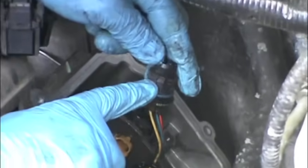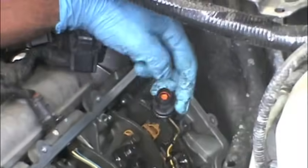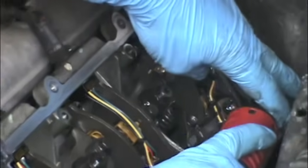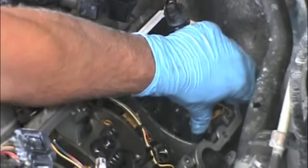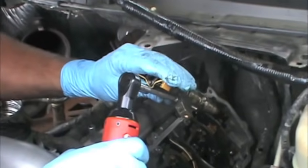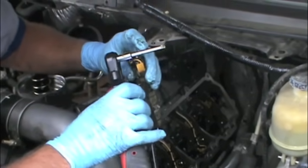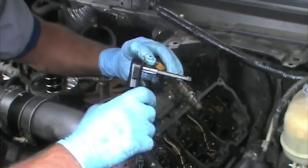Now you want to make sure all four are there — you've got two per side. If they're not there, give it some effort and look for it. It will go through your oil system and find itself to the IPR and you have a no-start. It's easier to find it now than being on the road. The injectors will come out by undoing the one hold-down fork. Depending on the year, it's either Torx 40 or Torx 45. You can see I have one here that's not your standard shallow length, so it gets it and it clears everything. You really should use a quarter-inch drive because of the thickness up here.